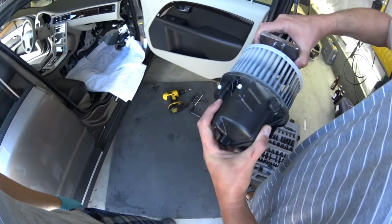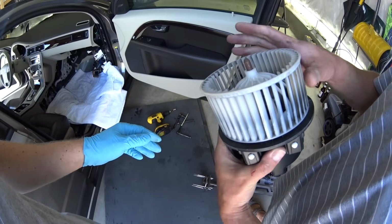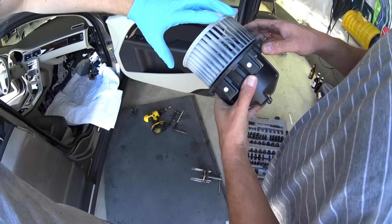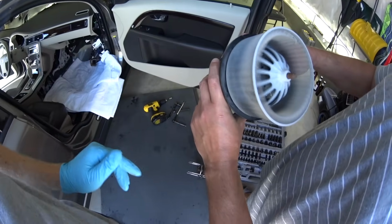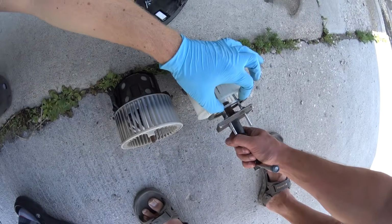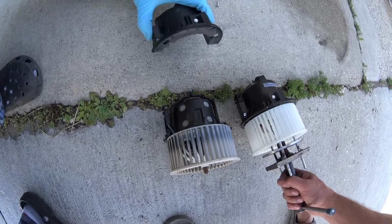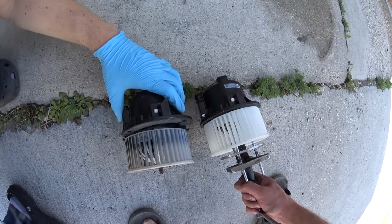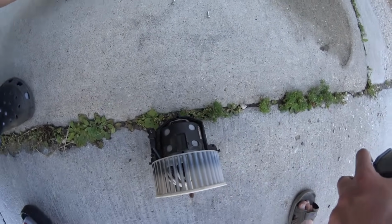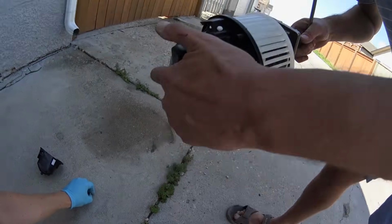I'm going to put a link in the description below to the video of how this fan was annoying during winter times. When it was freezing cold outside, it was squeaking like crazy. Really annoying. Finally I got to it. One more demonstration on how the tool is used to remove the fan. We took the cover off the old fan, and those wider pins sit around the square on the body of the fan, and this way you're able to unscrew it counterclockwise.